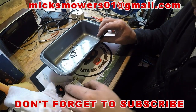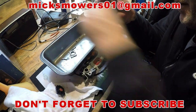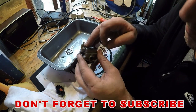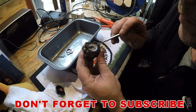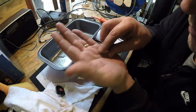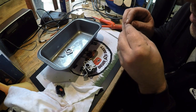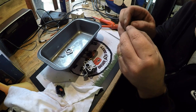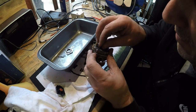Next, I've got to fiddle about with the spring and the needle assembly. Now these are particularly fiddly. You just take your time with them. That's the best method. And the spring sits on that little tiny bit just there. Now what I have noticed about this spring is it's got a very slight bend to it. I don't know if someone's been in there, but it shouldn't have a bend like that. So I'm just going to try and manipulate that so it's a bit straighter. It's going to be difficult. That's a bit straighter. So that spring sits on there like so.